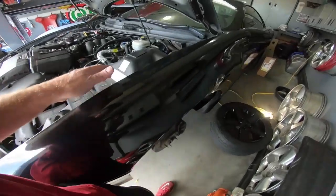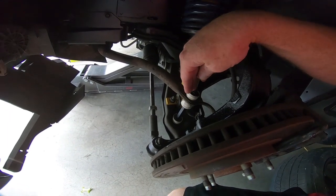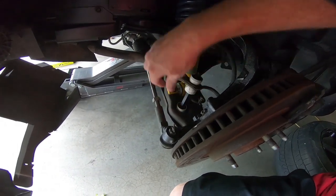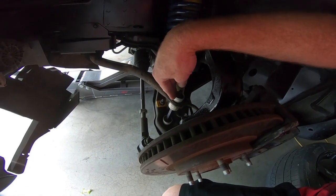I did go ahead and try to film this, but for some reason all my audio was gone. But I did put the new sway bar end links in. Those are Moog parts, and how those tighten down is you just sandwich them down until you can't spin this center section, and then I go a little bit past that. So those are replacements. I will list those in the description down below.